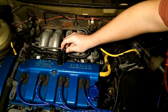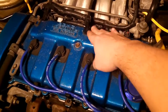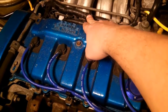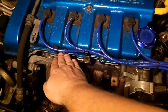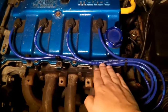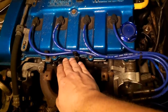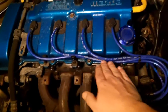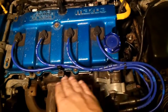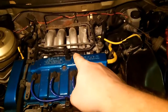This is your PCV valve right here. It sits like so on the four-cylinder. Now on the V6, the PCV valve is also found on top of the valve cover. The breather hose for the V6 comes out of the front port of the valve cover, along with the metal tube that traverses the length of the valve cover. In later models of the V6 — KLDE or KLG4, I'm not exactly sure which one — they completely did away with that PCV breather hose or pipe from the front valve cover, and there's only a PCV valve on the front.